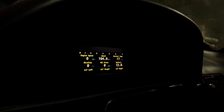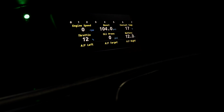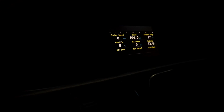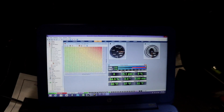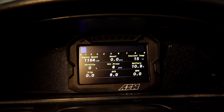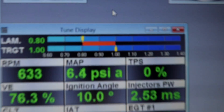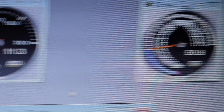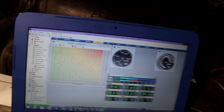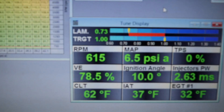We're going to mess with the design a little bit before we start the car up. If you look on the dash — I'm going to push the gas pedal down and you can see the throttle percent is working. I updated it a little bit and we're going to start the car and make sure the sensors are reading correctly with what we're getting on our ECU software. The AFR seems to be going off the lambda and not the actual AFR, so I think I have to change the input for that, but our engine speed is the same which is good.